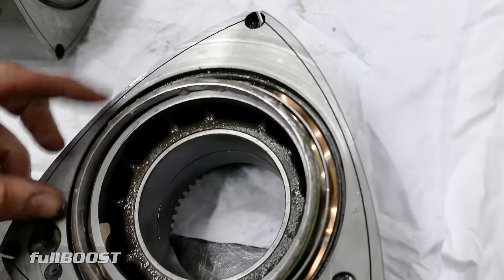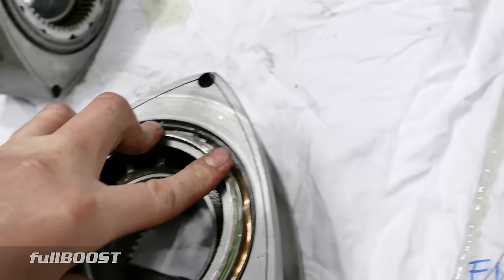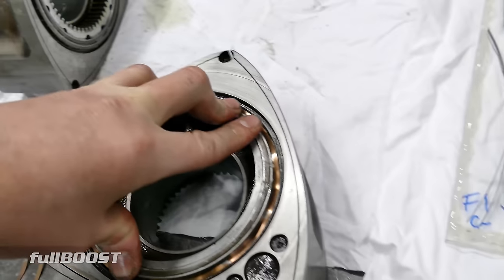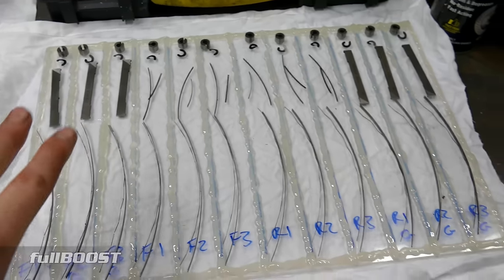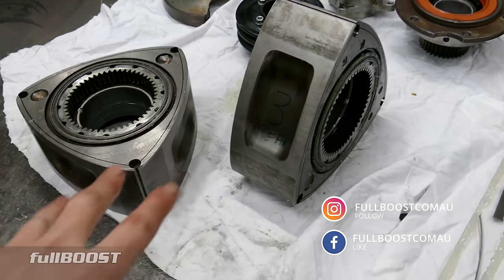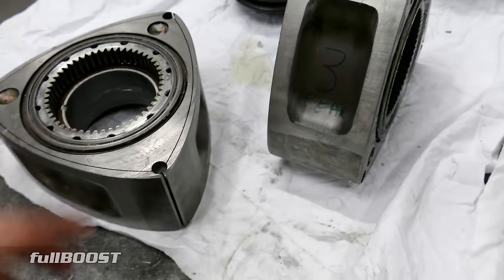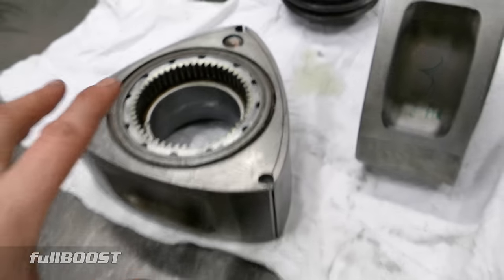Time to throw these in now. Building an engine with one hand — this inner spring is much easier to get in than the outer generally. Next is making all of this disappear into these two rotors. First, corner seals and side seals and apex seals. Flip it over, do corner seals and side seals again. And basically glue all this in with Vaseline so it holds in place. Then I'll do the same thing with the rear rotor.